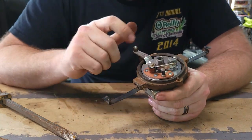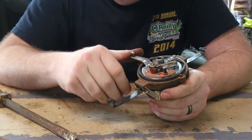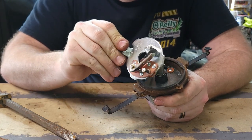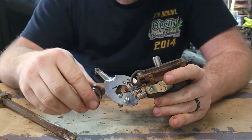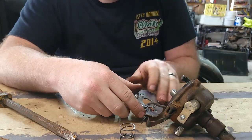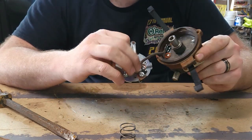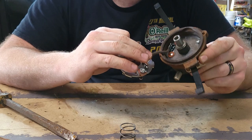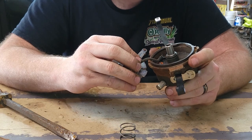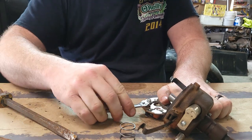Move those little clamps out of the way. The upper plate is held in — once you take that cam off — by just little tabs, so you twist it to the point that they pop open. Then you've got a little spring there; you're going to want that for the next one. The original upper plate is connected to the lower plate with a wire, and that's what we're getting rid of with the wireless bottom plate, because these are known to fail from moving back and forth and getting old and brittle.